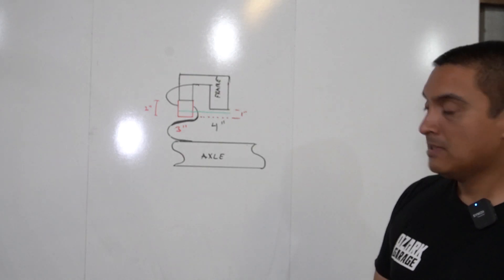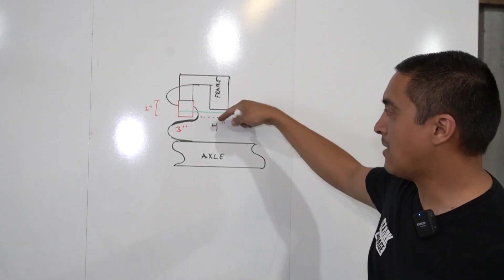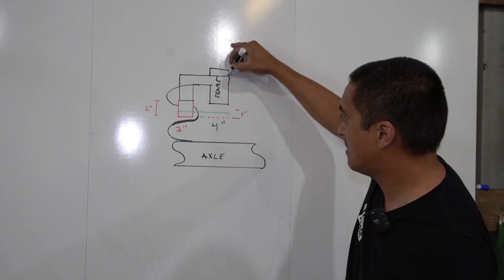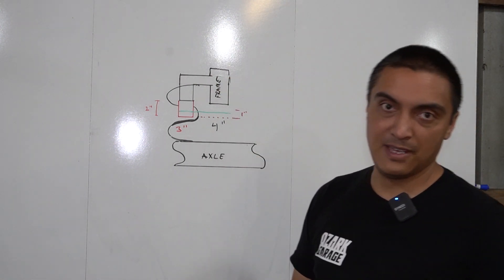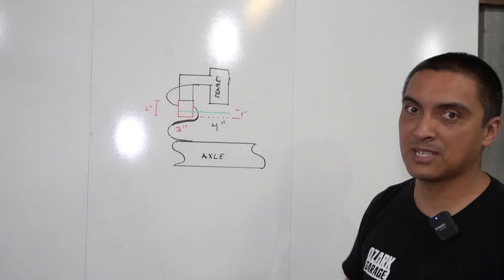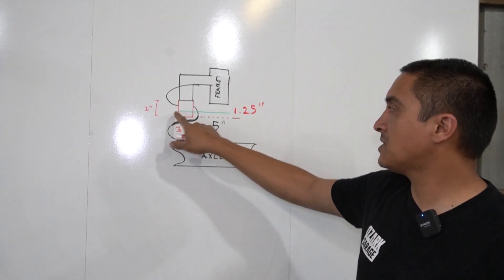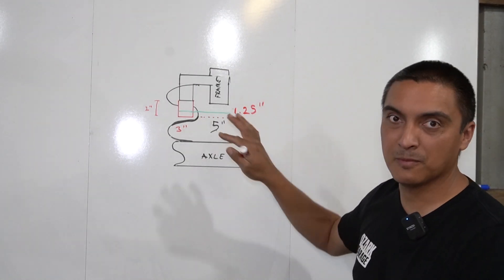So what I'm going to do is move the entire coil mount and bump stop down on the frame. Moving them down on the frame is going to move the frame up one inch — it'll actually lift the entire vehicle, which is something I was trying to avoid, but all things considered it's the best compromise. So then I'll have five inches of gap between the frame and the axle, and the Perry Parts bump stop will compress three quarters of an inch, giving me an inch and a quarter between the axle and the frame, which is a lot better setup.